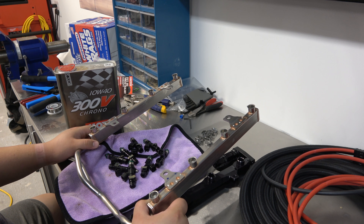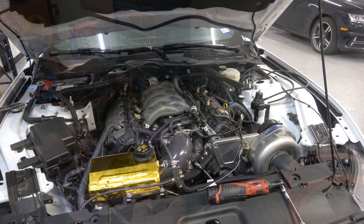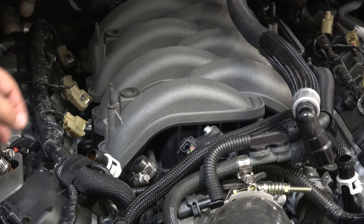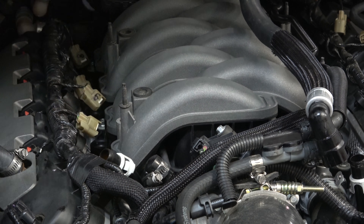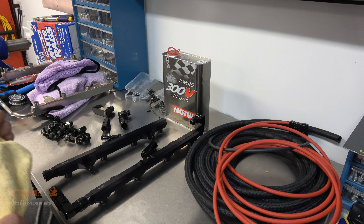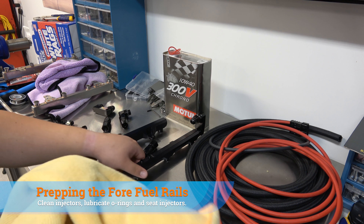The first thing is to unhook every injector connection — I've already got mine labeled. Some of them you need to work in and out a little bit; if your hands are big like mine this is not super fun. Now that you've got the fuel rail out, the goal is to pull the injectors. The fuel rail seems to be the same height as factory so I'm keeping the adapters and just pulling the bottom clip out. Your old fuel rail is going to have a ton of fuel left over — very carefully carry it somewhere to dispose of it.